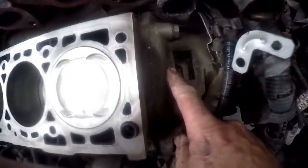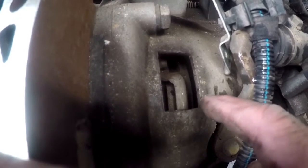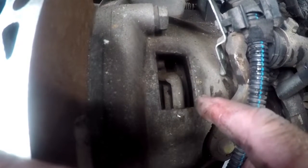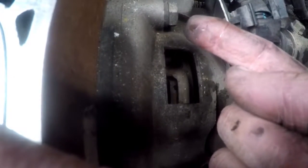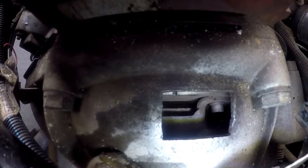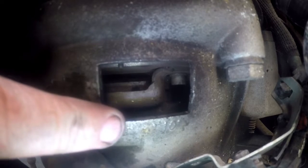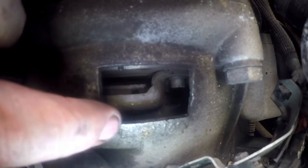This is the gearbox — it has a little rubber plug which you just take out of the way. If you look, there is actually a scale: zero, dash, five, dash, ten. So that's zero degrees, which is basically top dead center. Five degrees before top dead center — because the engine rotates towards us. There is a notch on the flywheel, and we put that notch opposite top dead center, which is zero. So putting the notch opposite zero gives you top dead center.